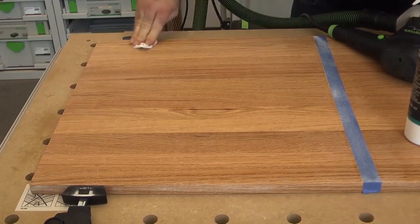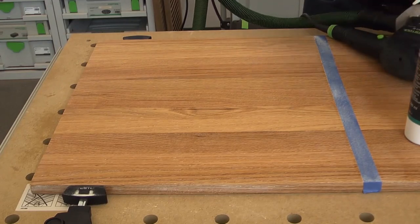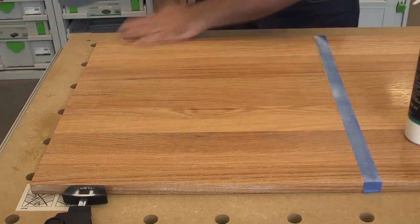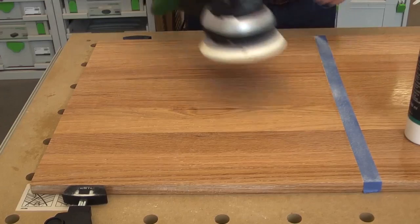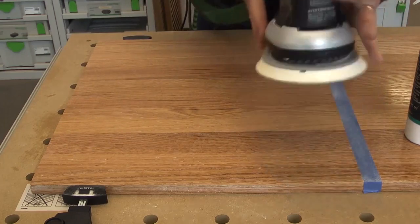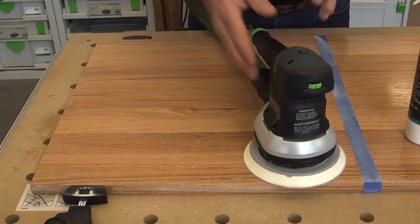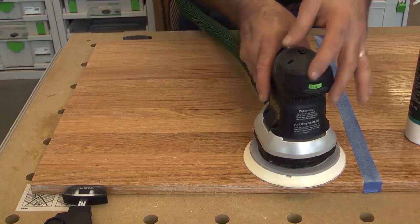But you'll see what we're trying to do is just get some nice flat surface. The next thing we're going to do is we'll put on 1000 grit and we'll do the exact same procedure. Okay. Wiping in between grits. Okay, and as you can see, as I rake a light across there, I'm getting what I need to get. Okay, always start the machine. I mean, you can start it off, but you have to bring it down flat because that could gouge. I like to start it here flat on the surface, and then always, when you turn off the machine, bring it off the surface you sanded, because if it sits here, you could get swirl marks.